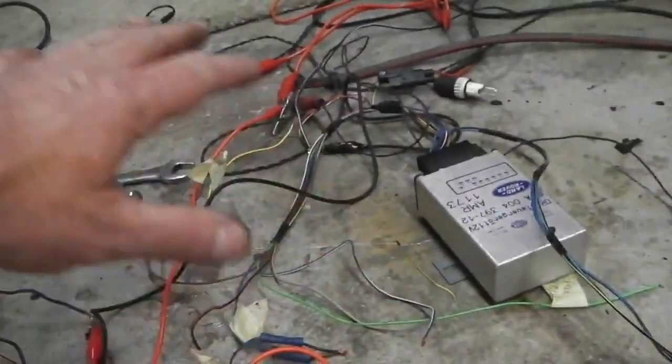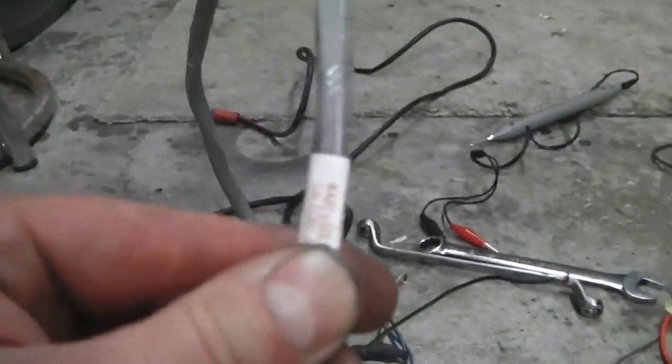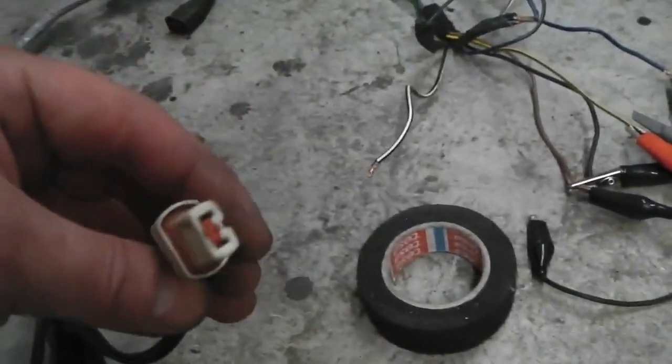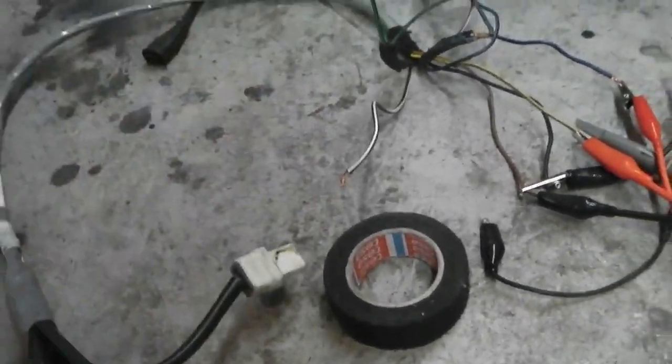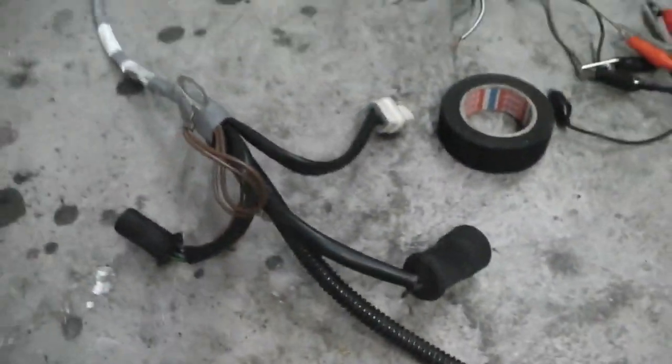A couple of switches, brake pedal switch. I've overridden the brake pedal switch by just joining it together for now to get the system tested. So all I'm going to do, it looks a mess, and it is a mess, but we start to neaten up. I've started to make the loom up here, going up this way. We're even including some Ford labels there, and the grey loom tape, so it makes it look factory. So that's our loom. It's got our reverse switch, park inhibit, torque converter lockup, we'll talk about that, excuse the pun, later. And the kickdown switch, which is going to need the kickdown relay again, we'll talk about that later.